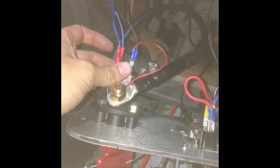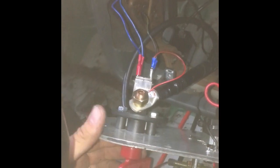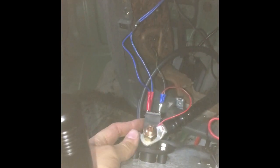These switches have two sets of contacts on the back. This contact here is closed when the isolator is on. What I've got here is the earth supply - the negative on the relay for the ECU - teed into that. So when the isolator is on, that circuit's made and the earth is there for the relay for the ECU. When the isolator is off, this contact opens, that breaks the negative to the relay for the ECU, which drops out that relay and opens it up.